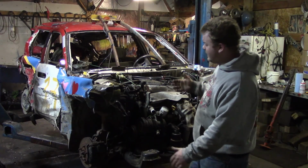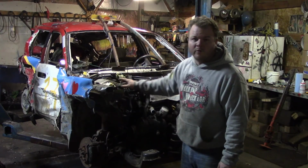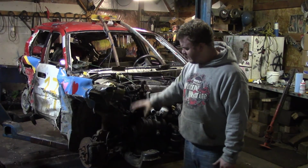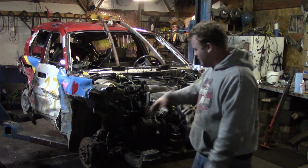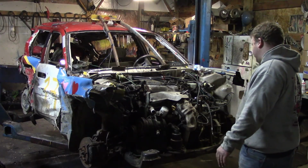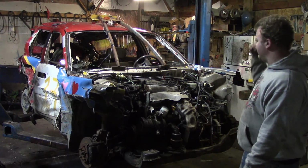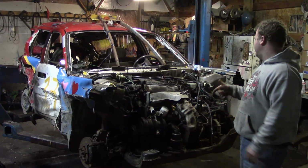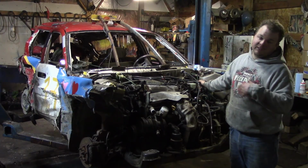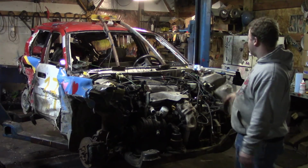It's super, super easy. The other thing that you're probably going to have to do is take out your power steering reservoir, because that's connected to the motor. It just quickly disconnects off of here, and then there should be one or two bolts for your return line. But yeah, this thing's going to be out very shortly. So let's get the throttle cable, the transmission cable, the fuel line, the electrical, and the DuraSpark, and then we have to disconnect our main power, because we run it a little bit differently for Demolition Derby. So let's get that done.